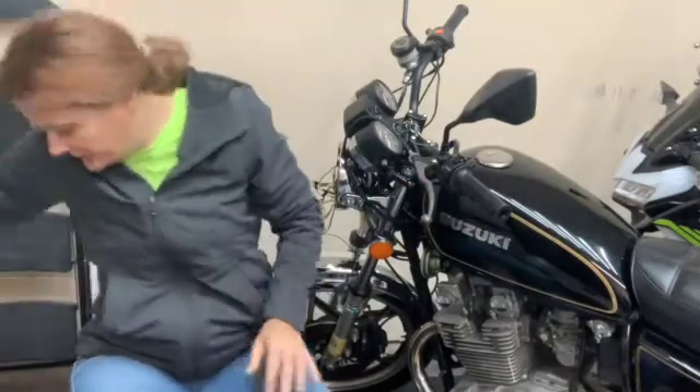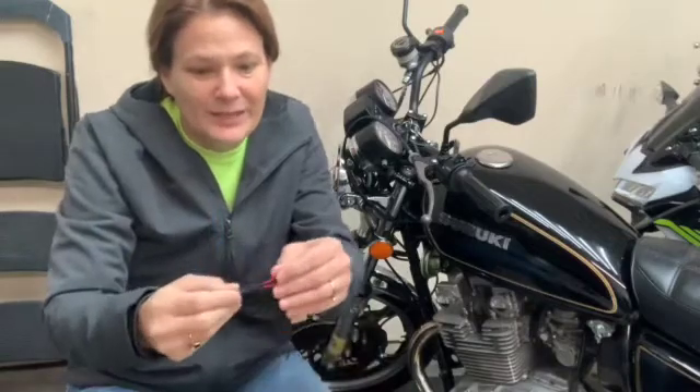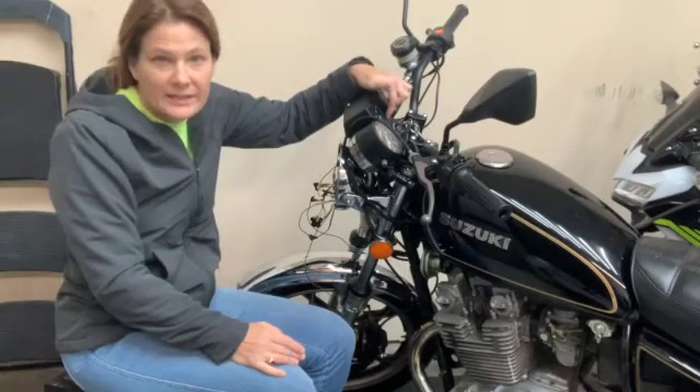Let me show you what it looks like when it's done. My husband ordered me a diode kit, but he also ordered me one of these pre-made assemblies so I didn't have to make it myself. It's basically just two of those little diodes twisted together on one side, with a wire soldered through and legs with wiring on each end. I looked through my owner's manual to see the wiring diagram and found that the light green and the black wire were the ones coming from the indicator light.